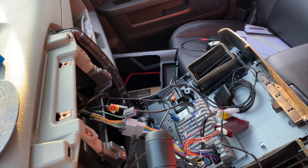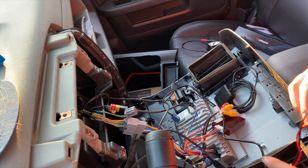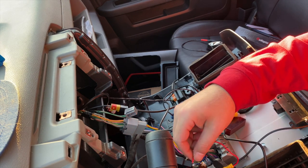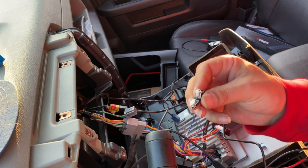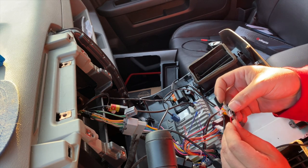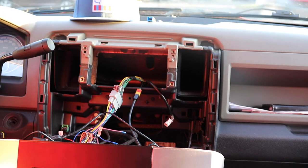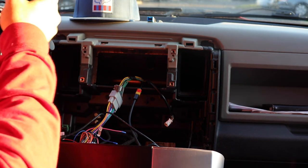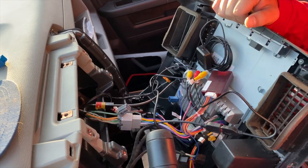I've also got a backup camera that I'm going to wire real quick so it's ready to install later. I've got the wires stripped for the aftermarket backup camera, and I'm going to use these quick connect connectors I bought on Amazon — about six bucks for 12 of them. You just put the wires in and close them and it makes a perfect connection and seal. I'll link these down below in the description. Crimp them nice and tight, then run this wiring down here so I can get to it later.